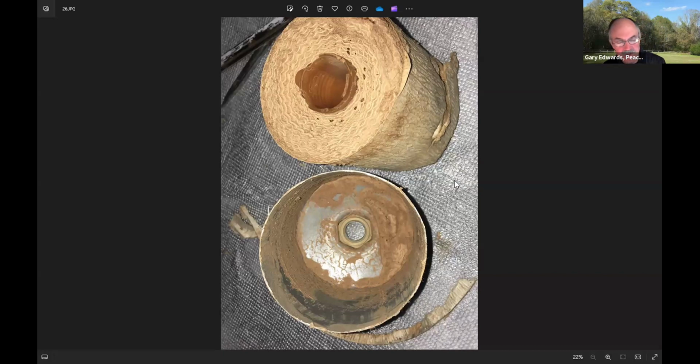One of the other times it quit when I was just about done, and I had swapped the manifold pressure control back into it, and it started running again. I put the original, the good one, back in, and it ran again. My problem was that the electrical connector on the manifold pressure control sensor had come out a little bit. And that caused it to quit.